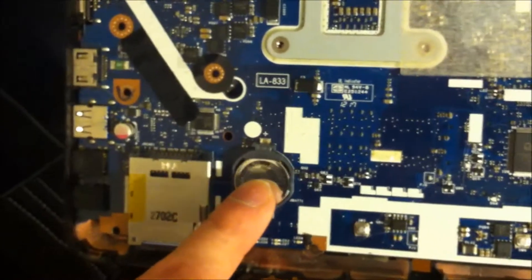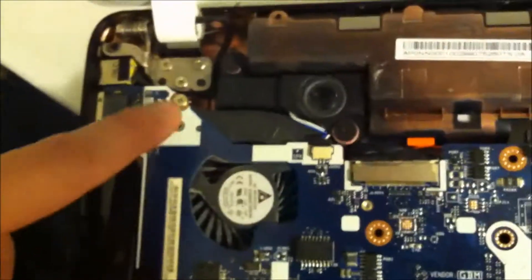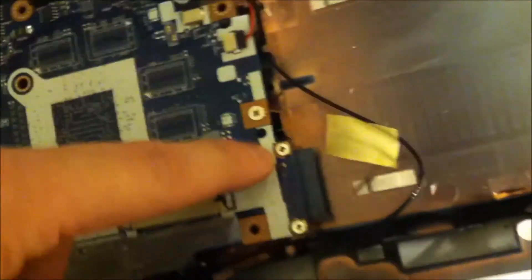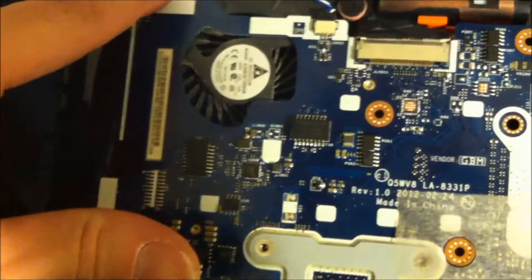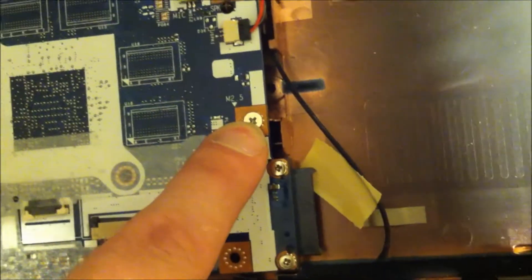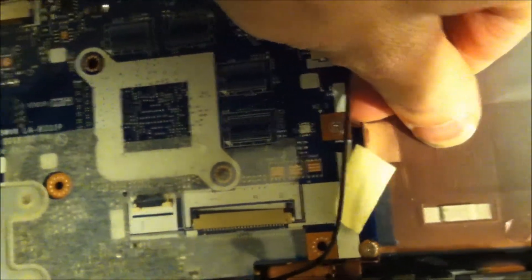Here's your battery. There are four screws here for that housing — you don't want to touch those. That one goes for the housing for your hard drive. It looks like there's only one screw here that holds it down, and you have a few more connections to take apart, especially this screw here which holds that side down.